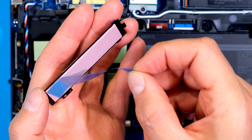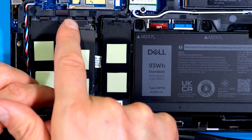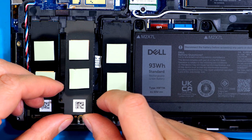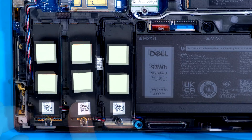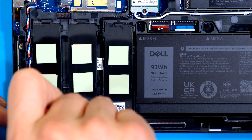Be sure to remove the protective cover on the thermal tape. Start by seating the thermal cover into that space over there — there's a lip there and a groove or space there, so I allow it to go in there. Then go down slightly at an angle and press down to seat it into the loop over here. I now replace the screw that holds the thermal cover and the SSD in place.